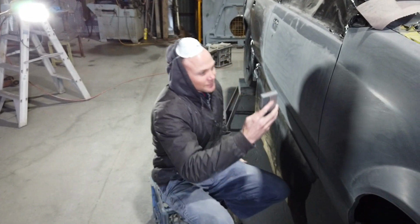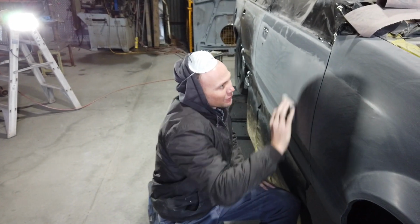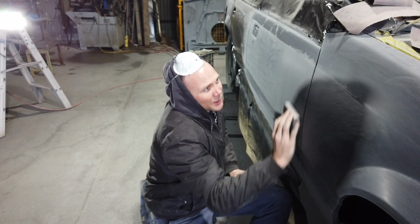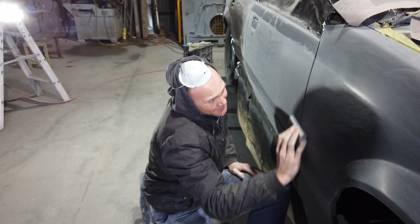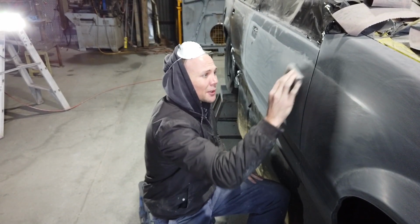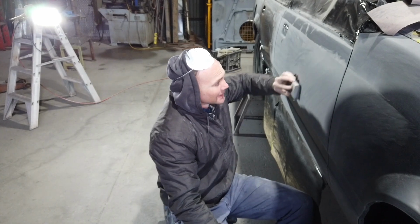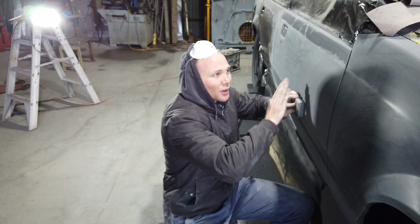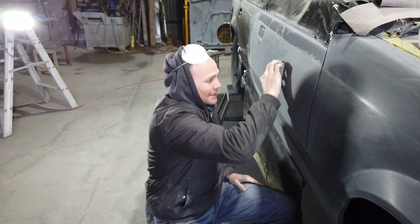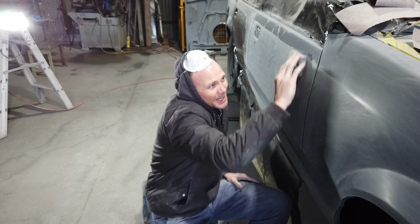This part of it now is very important, because you've got to keep the block dead straight. Every little bit of a rub's got to be perfect. You can't just hit and miss it. It's got to be all in line so it comes up perfectly. But what we do then is we'll cross back over, rub it like a cross. Once you go back over this way, you can see it's cutting it like a knife evenly, and then you come back again this way. And what that does is cuts it all dead straight in this area and brings it out where it needs to be.